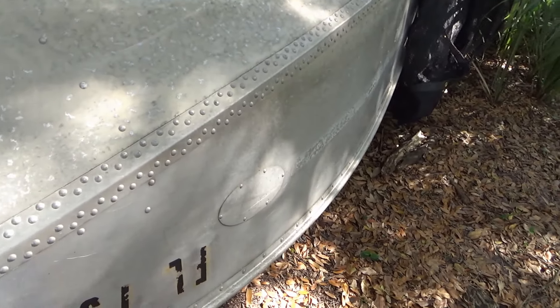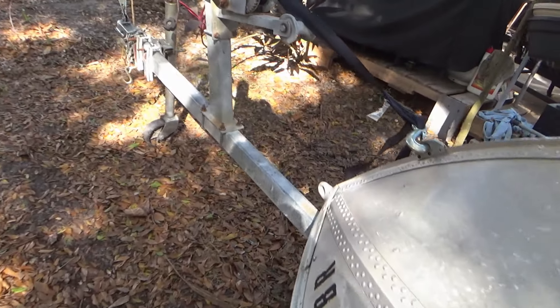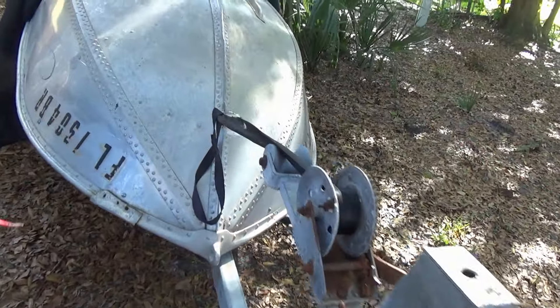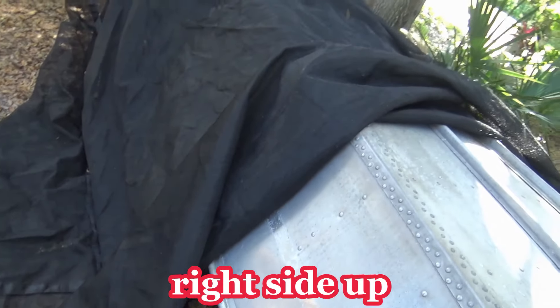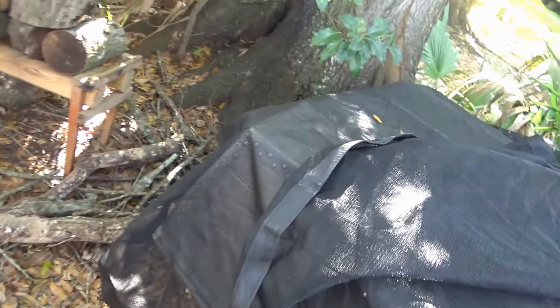What I'm going to do — I'll go over this with a little wire brush, clean it up, and take that Loctite Marine I love so much, and just fill all these seams in real nice. Then take it down to the lake, dump it in the water, and see if I got any rivets leaking. That way I can see where it's at, mark where it's at. When it's upside down on the trailer you can see it leaking up here. I've got some JB Weld or something for any rivets that are leaking.